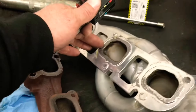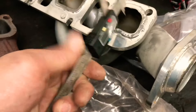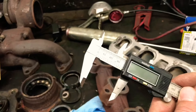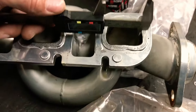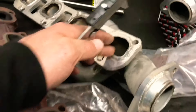First and foremost, the primary on this header — I'm going to measure here to here. I'm also going to measure the exhaust outlet on both. The JBA primary is roughly about 36 millimeters. The manifold is about 31. Width-wise, we've got about 46 millimeters on the header, and on the manifolds about 44 to 45. So these are a little bit bigger than the manifolds, just a tiny bit — by a few millimeters, not much.